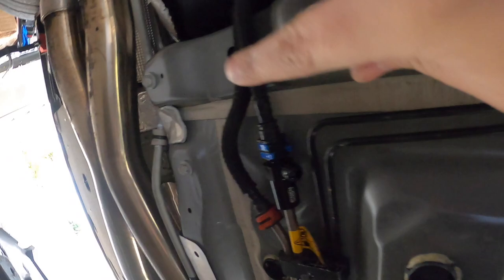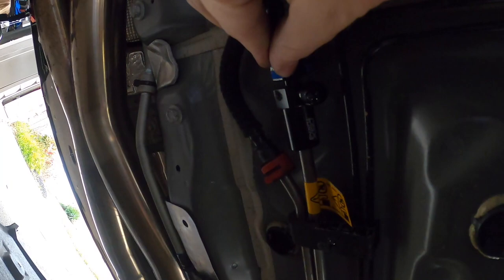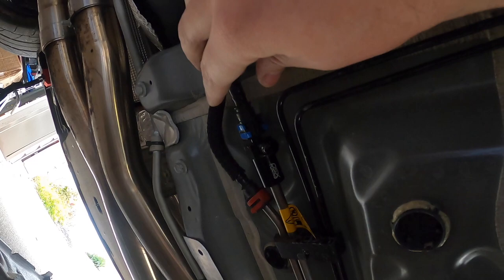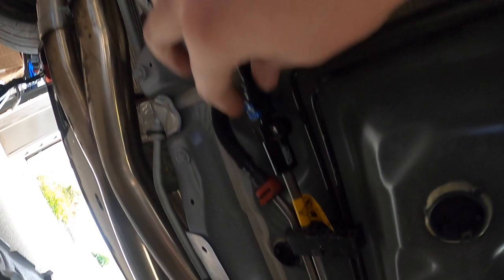Okay, the adapter is in, guys, and be careful because it will squirt some fuel. You guys can see there, but it's super easy. Just make sure you open up the two little wings here on both ends and slide this blue clip out, and then that just slides back out. There's no pressure or anything there, which is really nice. And then we just slot in the DSX tuning adapter here, which has our fitting that is going to run the hose from the fuel pump.